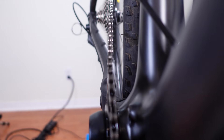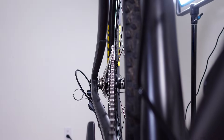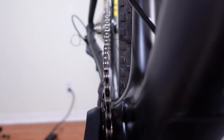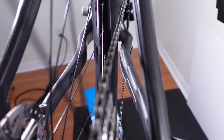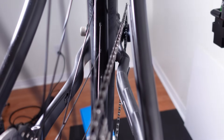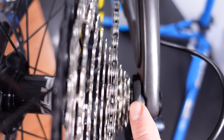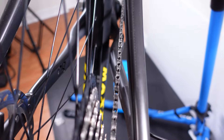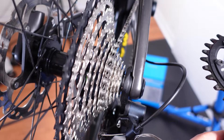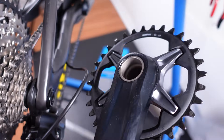If you're wondering how extreme the 55mm chain line is on a 12-speed Shimano drivetrain — I'm not dropping the chain from the largest cog, the 51. It is extreme indeed, but I guess it would be usable. This bike has a 433mm chainstay. If your bike has even shorter chainstays, 55mm chain line might be a bit too much. Chain is on a straight line from the chainring to the cassette on the 5th cog from the smallest. If you were to use two-thirds to 75% of the cassette, nothing's too extreme — it only gets more extreme when you make it to the 51 tooth. This wouldn't be any different than what Shimano recommends for non-boosted frames, which is the 7100 at 52mm chain line. I just hope Shimano tested the heck out of it and it works okay long term.